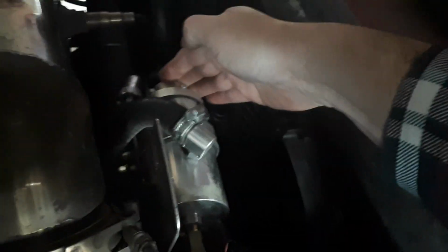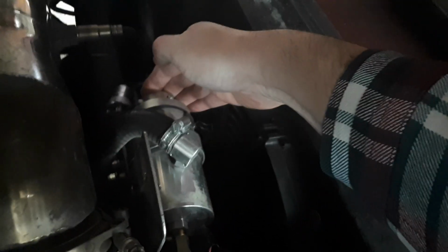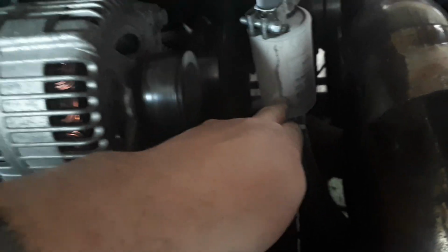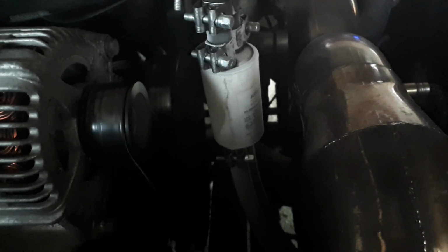So here's the vaporizer here. We've got no freeze up at all on the vaporizer. I'm touching it now. It's fairly warm. At the end of the vaporizer where the valve is, it is freezing cold. But here's what we see. Here's the frost. The frost is actually in the filter. So I'm just going to scrape a little bit off here. That's all frost. So the main point of weakness with the system is the freezing of the LPG filter.